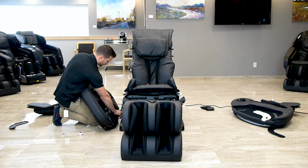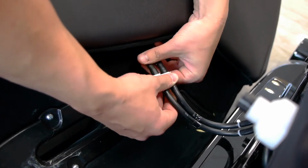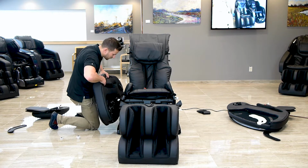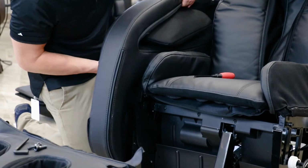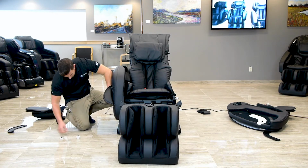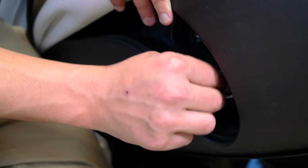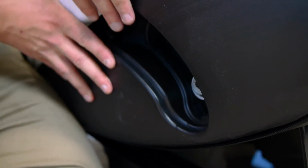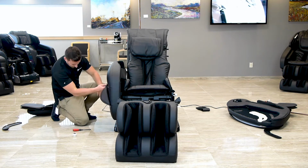Once those are removed, locate and attach the 2 armrest air hoses to their respective air tubes on the chair. Then, place the arm onto the shelving on the side of the chair, using your body for support to hold it in place while you open and pull up the zipper flap to access the opening. Then, reattach the front arm bushing with its screw and washer, hand screwing it into place. Shimmy the back of the arm until it secures into place on the armrest lock.